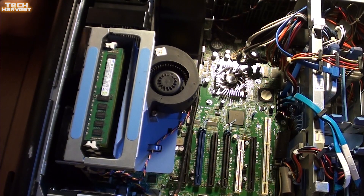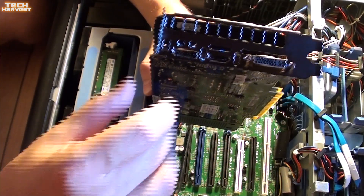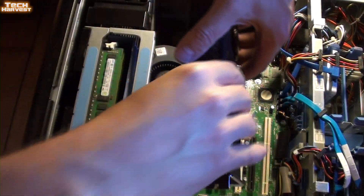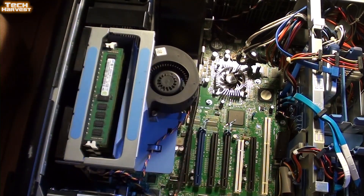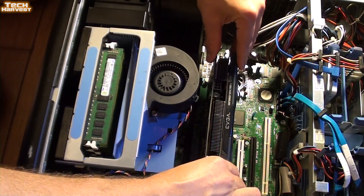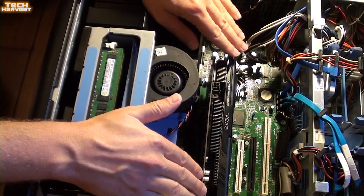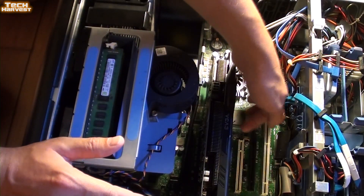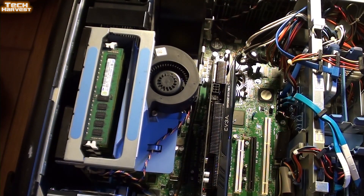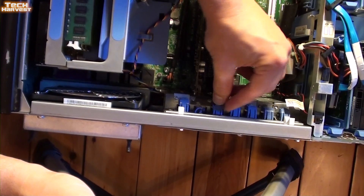This is going to install the same way as the other one. On the back there are three connectors: a DisplayPort, an HDMI, and a DVI. We're going to use the same slot as before. I lined everything up — this is a much smaller card. I pulled the plastic tab up a little bit to let it in, inserted it into place, snapped it down, and moved the tabs back into place to lock them down. That locks the card into the slot.